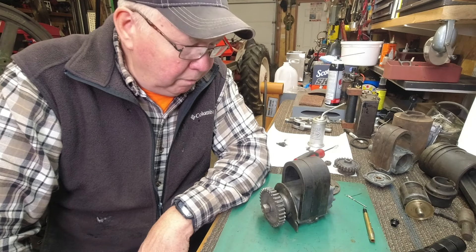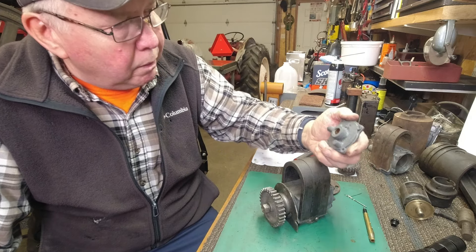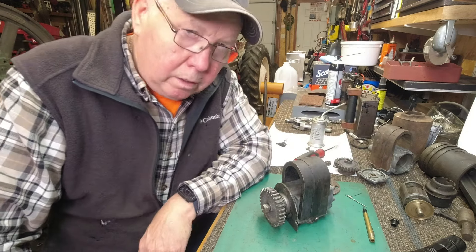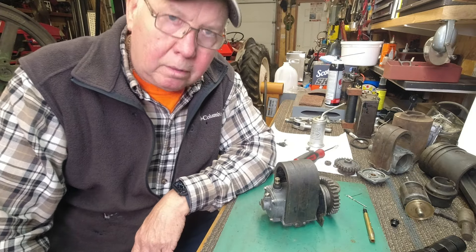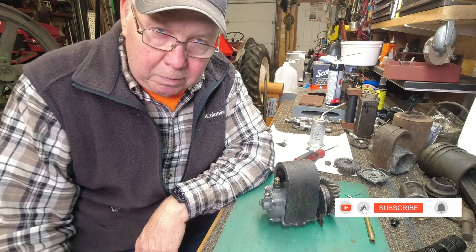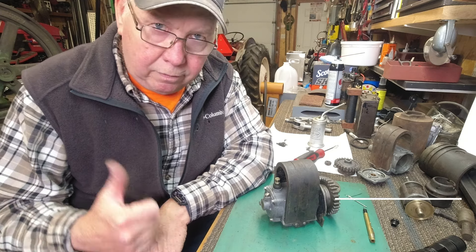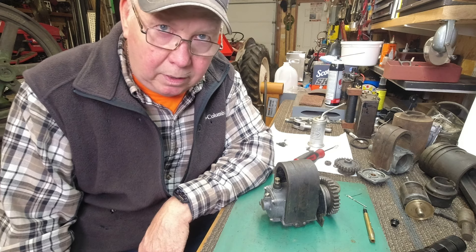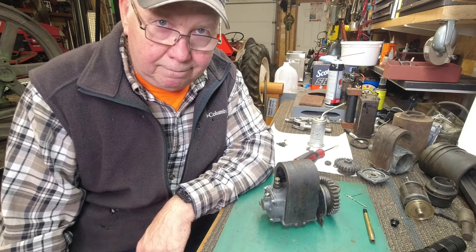I hope you enjoyed this little dive into these magnetos. Sometimes you get a good one, sometimes you don't. You've got to watch when you go in and make sure that your aluminum housings are not cracked up and beginning to rot — that causes all kinds of problems. But as you saw, these magnetos are pretty simple and they seem to work pretty good. Thanks for watching — if you enjoy what I'm doing, hit the like button and look for me on the next one. I'll put a link at the bottom for the restoration of the three horse that this is going on.